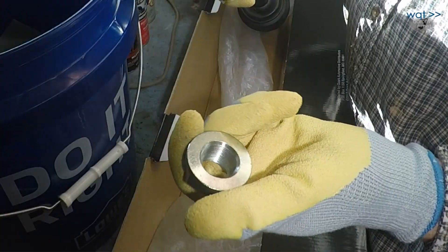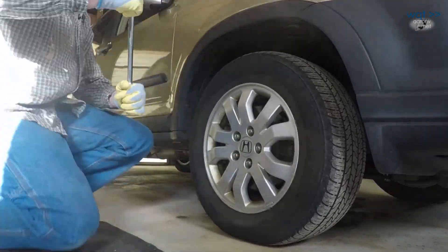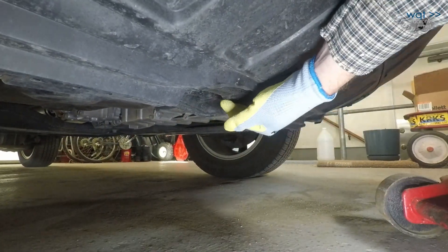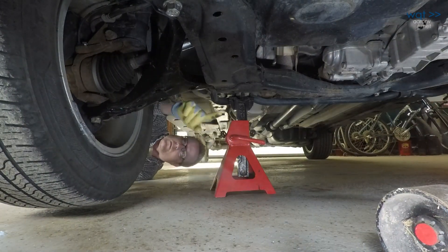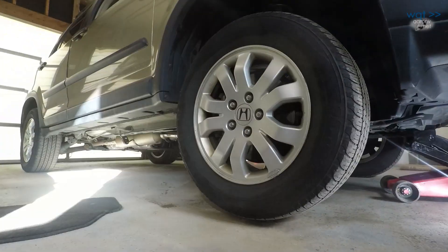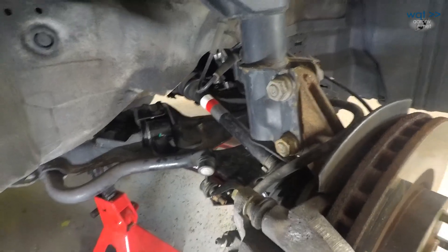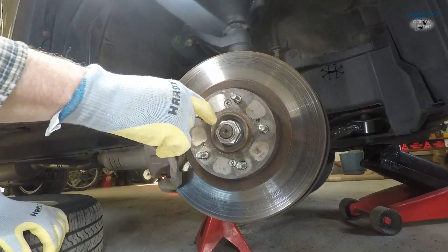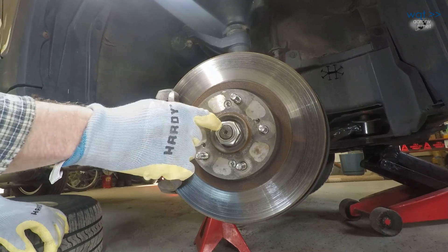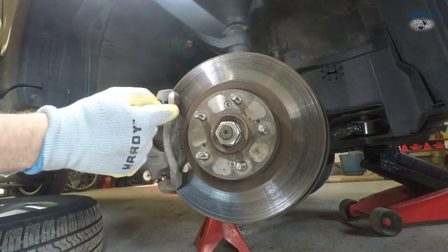Here is hopefully our replacement axle — it looks like the right one. The right front axle for this Honda has a spline insert on one side because there is a stub axle between the transfer case and the transmission, with a carrier bearing. Today we're lifting this corner only and removing just this wheel. As with our previous ball joint episode, we're assuming this isn't your first time doing suspension and axle work. You will need to properly lift and support the vehicle for major disassembly of structural components. The next step is breaking the torque on the main axle bolt — do this before removing the brakes. If you're using a breaker bar, definitely have someone else standing on the brakes.